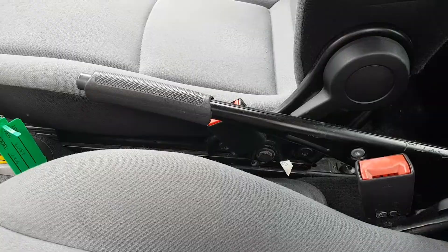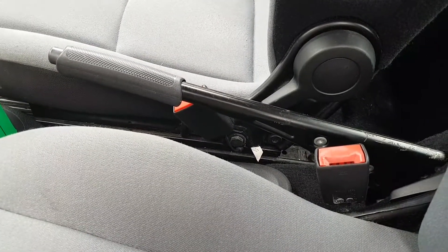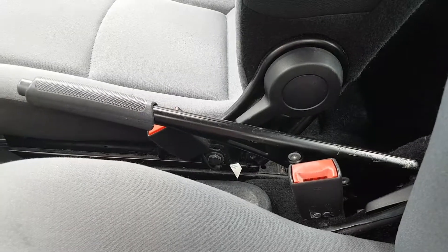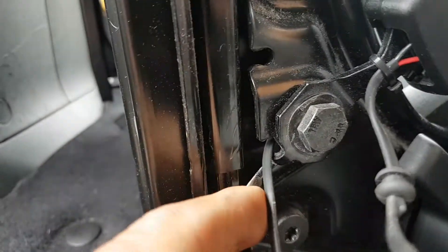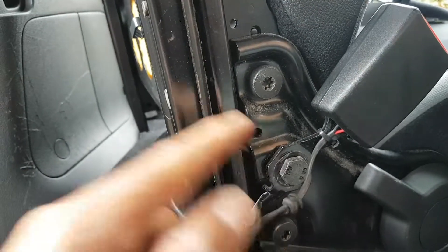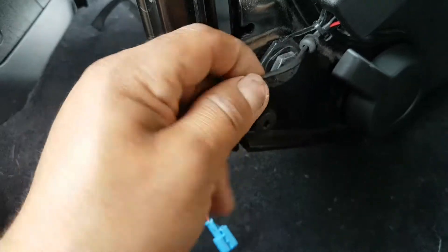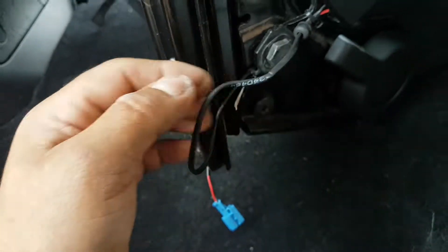I think what I'm going to do — where is this supposed to be? Oh, this grommet here is supposed to be protecting the wires. So let's remove the seat, get these repaired and protect it from happening again. With the seat removed it's a lot more understandable why this happened. The cable is going through there but it's actually supposed to go through there — that's why this grommet clips in there. The cable was routed incorrectly, which is why it started to chafe.